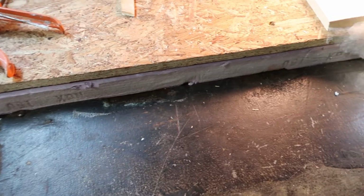In the front of the bus, we made sure that we followed this line. Ahead of that is going to be automotive carpet with automotive insulation, and then sound deadening mat underneath that. So that's gonna be quiet up there, it doesn't really need insulation. But as far as the rest of the bus, all of this is finally done.